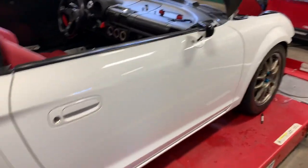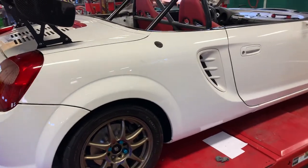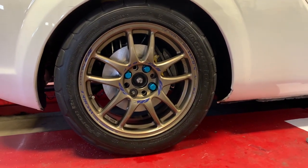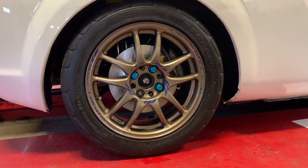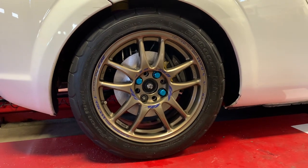The car's coming along - we did some brakes. I was trying to decide whether to go crazy on brakes for this car, and I elected to just go with factory plain rotors with EBC yellow pads and Goodrich lines.